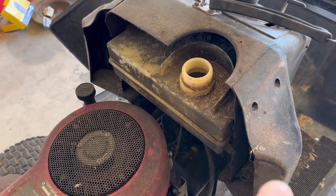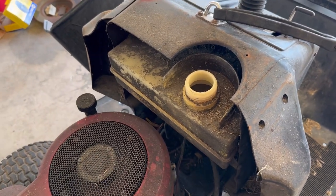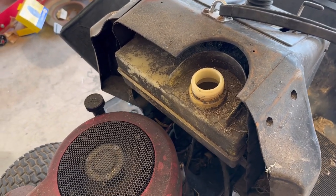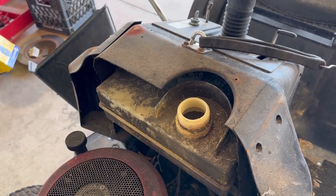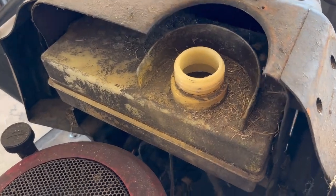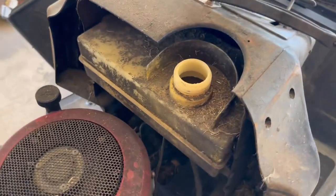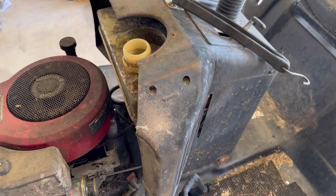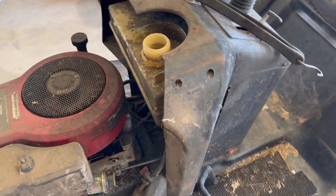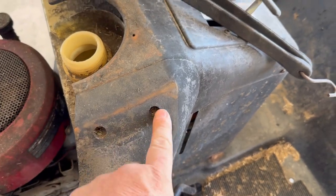You can tell that this tank's been leaking or seeping for some time around the edge — it's just got a bunch of dirt built up around the tank. That's a telltale sign that you have a leak; all that dirt likes to stick to it. But this gas tank is pretty easy to replace. You shouldn't have to do anything like remove an engine or take a console out.